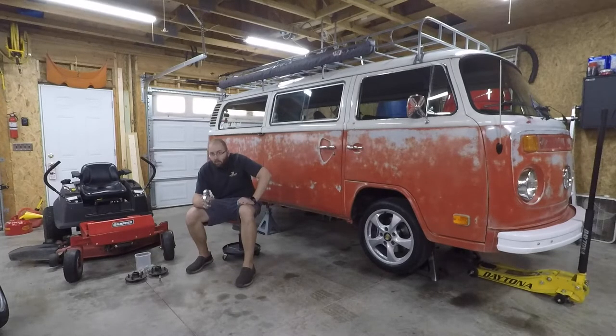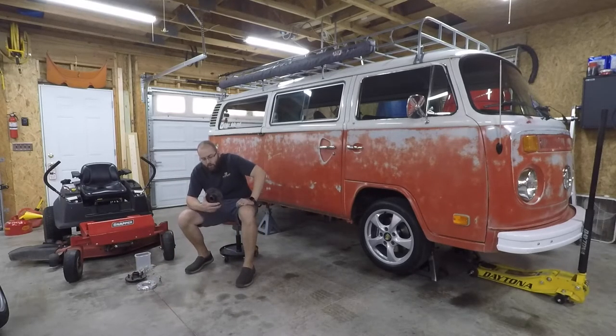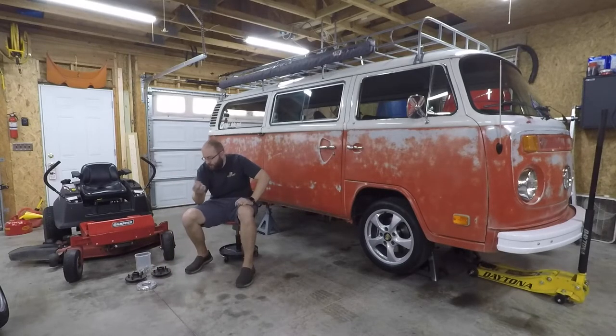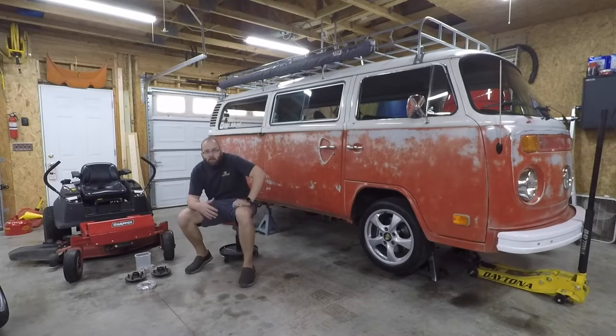The more likely course of action that I believe I'm going to take here is actually to go ahead and get the actual wheel hubs re-drilled. So I think I'll go visit a local machine shop, get these studs pushed out, and go ahead and re-drill the actual hub for a 5x130 pattern. I'll be able to use basically the same studs that were actually in my adapters. And then that'll give me 5x130 straight from the drum. Of course, I'll need to drill the drum as well. It should be pretty easy to do. I can actually do that here in the shop with that as a template.